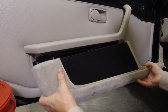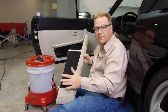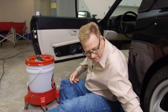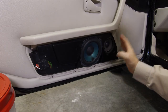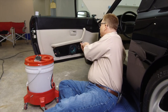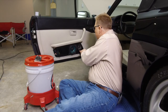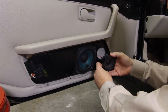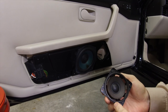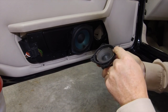I've taken the time to take this apart — this is the cover. I've cleaned the carpet and just masked it off and spray painted it. Also back here, because of the age, these are all broken, so I've put a bit of epoxy glue on them to refurbish this piece. But what I wanted to show you is this portion right here — you can see that the foam gasket that goes around the outside has disintegrated. So I'm going to take these screws out, pull these off, undo this one, pull it out, and these little connectors here just come undone. This is where that foam gasket has disintegrated and fallen apart, so I'm going to take this piece off and replace it.